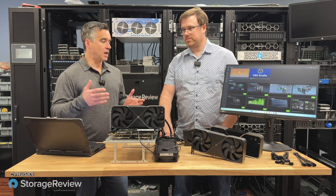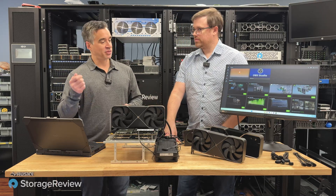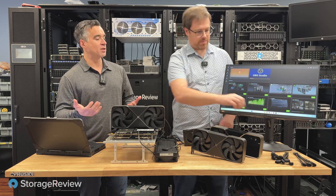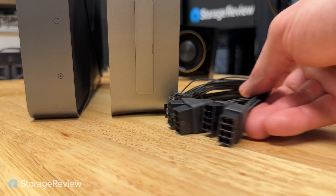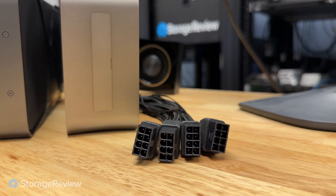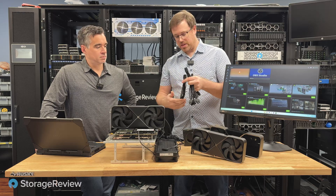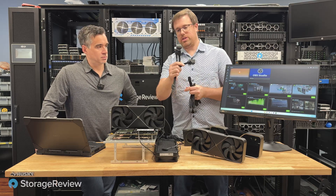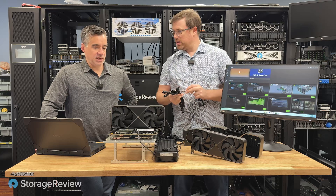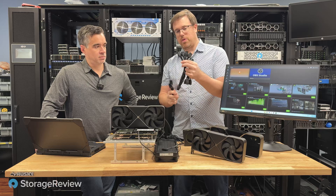A lot of consumer platforms are designed around one large graphics card, and if your top-end limit is 450 watts, that's all you have available to that graphics card. It's a system design issue — we've got a gaming PC in the other lab and tried to throw the 5090 in there. You got three connectors in and realized you needed a fourth, and there just wasn't any more headroom. What Brian keeps referencing are those eight-pin connectors — eight-pin adapters to a 16-pin connection that goes into the graphics card. The smaller cards use three eight-pin connectors, giving you around 450 watts — that's for the 5080.